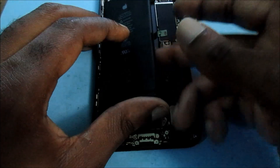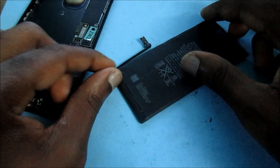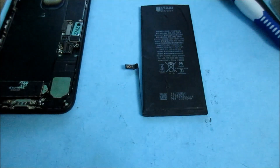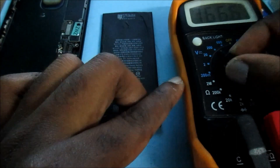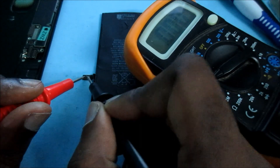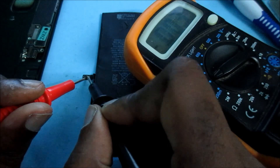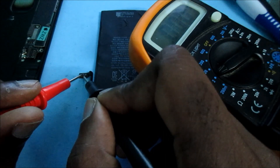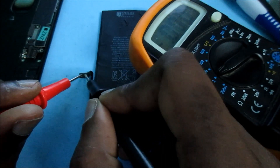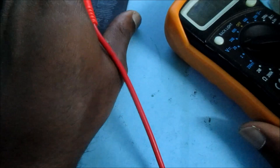You will have to replace your battery. Let me take the battery out and perform a simple test using a multimeter. We are not getting any sort of voltage coming from the battery — nothing at all. So this battery is completely depleted. I will try and see if I can recover it.